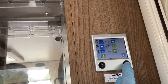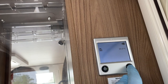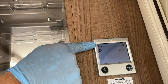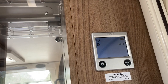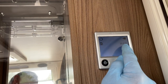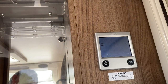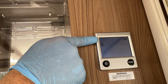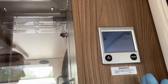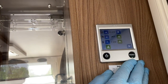Back on the standby menu: a circular symbol with directional arrows indicates central heating fluid circulation through the radiators around the vehicle. If I lower the thermostat below current temperature, the circulation symbol disappears because the thermostat is satisfied. To increase warmth, raise the thermostat; to lower it, reduce accordingly. In summer, I'd set it down to the lowest setting — around 5 degrees — so it only serves the hot water.